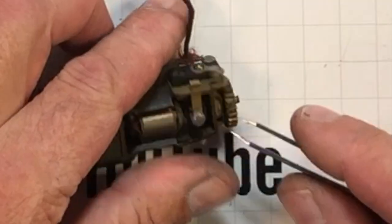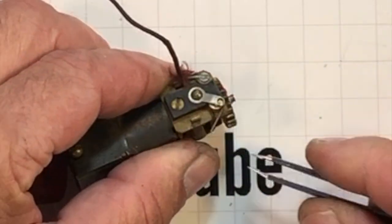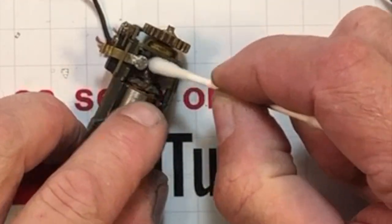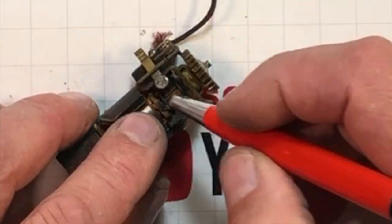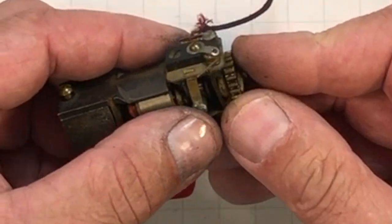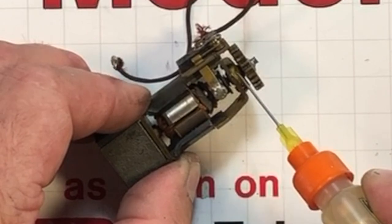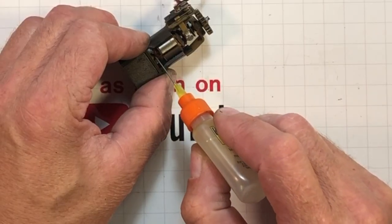Should we check our gauge? To clean this armature, take this spring out of the way, get the brush out of the way, get in here with some mineral spirits to clean up the grease that's on there. Follow it up with the fiberglass pencil just to give it a little polishing. Put our brush back in shape, put this spring back in. This one's got a wick up in the front here also, so we'll saturate that wick with some oil for a reserve. Give it a couple tastes on each end of the armature.